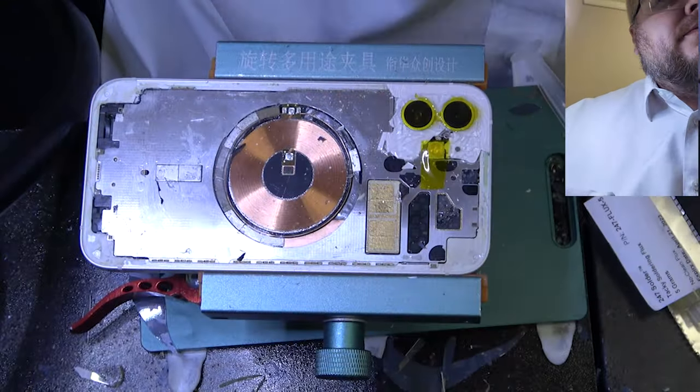And now that you've successfully removed most of the glue off of your phone or back glass here, just making sure we got it looking good. I don't want this excess plastic sitting up either. The rag takes care of glass shards, really. It doesn't have to be absolutely perfect, but the cleaner you can get it, the smoother of a seal you're going to get.